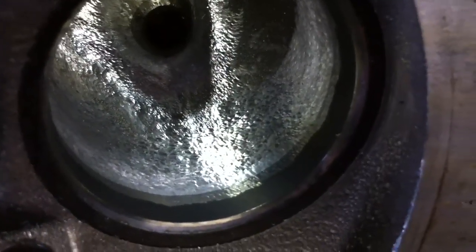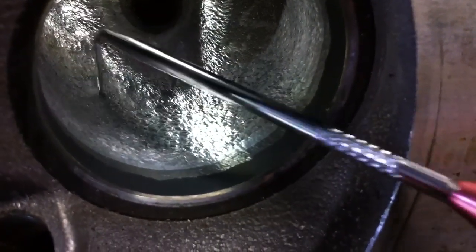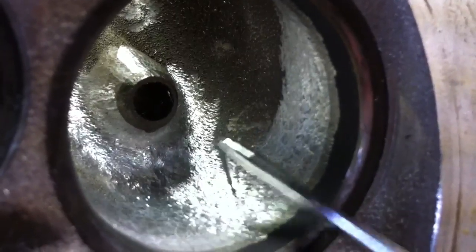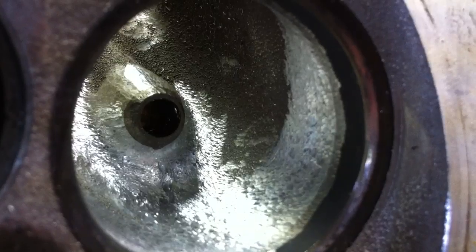Get a smooth flowing blend — you don't want any turbulence caused by air passing through and coming into the port behind the valve. Remember, this is a rough cut; we're going to come through in a little bit and take out all of the tootsie roll and smooth it all out afterwards. Right now we're just grinding everything down and getting it ready, starting to come through the tootsie roll.